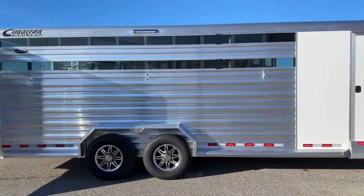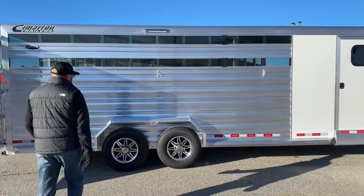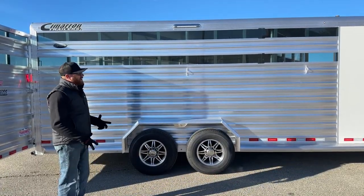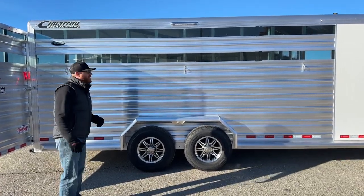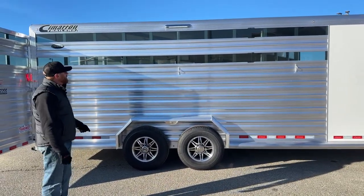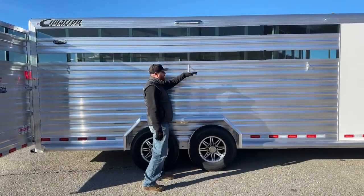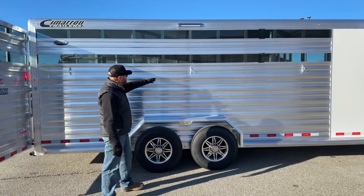On the top rail, you'll have a couple of those LED marker light buttons, and in the middle where your axles are, there's a 16-inch awning light — another LED that shoots down and out. We prefer these over pedestals because pedestals stick up and protrude off the trailer, making them easy for a tree to knock off. The awning light drastically reduces that chance. You also have tie rings — three on each side — and you can add more wherever there's an upright post.